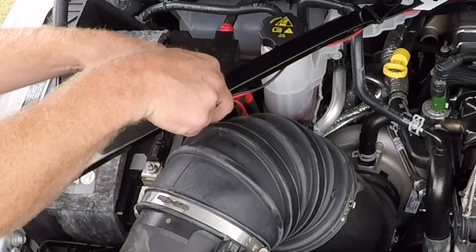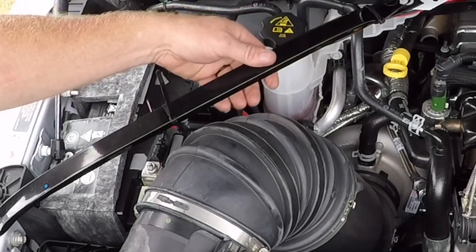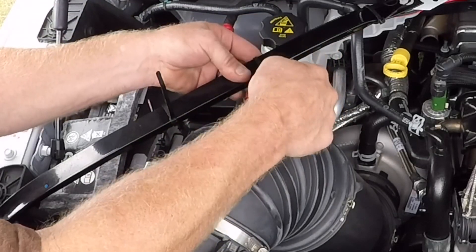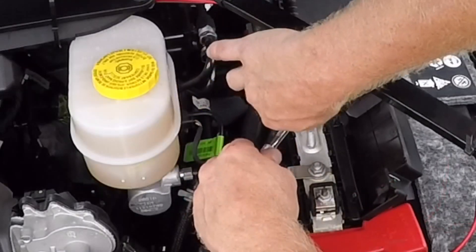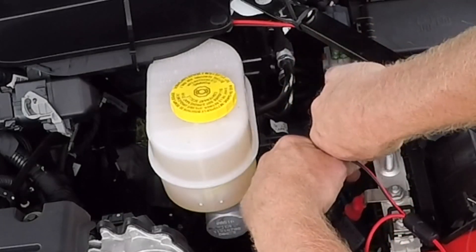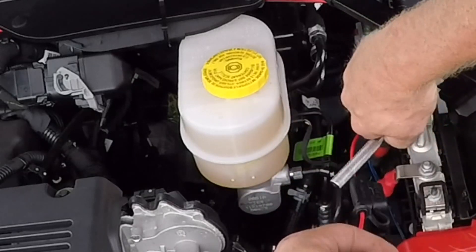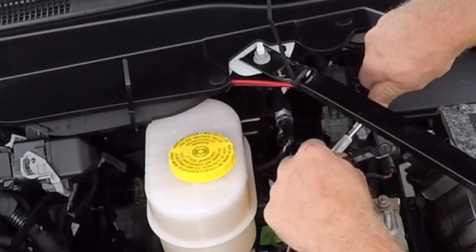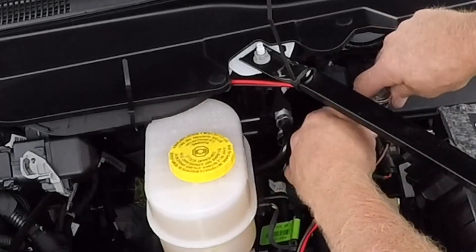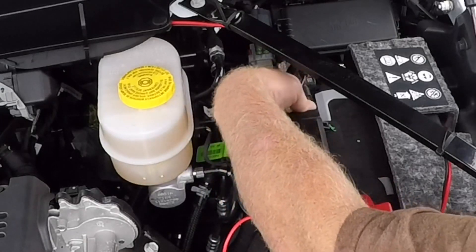I want to make sure my wires are tucked where I want them, nice and neat. I'll slide my zip tie down, tighten it up, and add a few more if I need to. Slide them into place, tighten them all up, clip the ends off, then move back over to the other side. Over there I'm going to use a nice terminal block underneath this cover - I found a nice stud on the positive side. I'll put my ring terminal on, rotating it a bit so the cover will be able to close. Then I put the negative terminal on and close the cover.